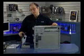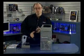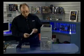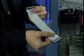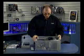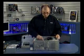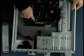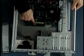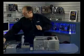Now the hard drive is installed, and at this point we can cable all of the drives. I already talked about the two ATA cables; we also have a floppy cable that goes with the system here. If you look at the floppy cables, you'll see there's a twist — the connector that follows that twist is the one you plug into the drive. So we're going to plug one end into the motherboard and the other end into the drive itself. I'm going to turn the system on its side to get a little better access. You can see the connectors on the motherboard for the two ATA ports as well as the floppy drive. The two ATA connectors are 40-pin, and the floppy drive is a smaller 34-pin connector.